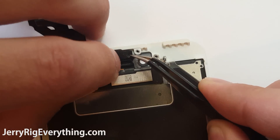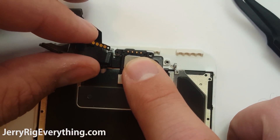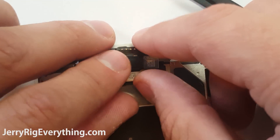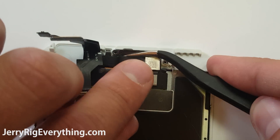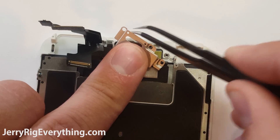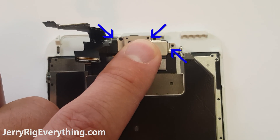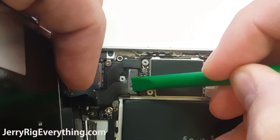Line up the microphone with its little plastic pin at the top, and get the sensors in place. Then take your earpiece and put it down, making sure the little niblet is tucked inside that little hole. Each of the little gold springs will line up with the gold circles on the ribbon cable — it looks a little messy but it sits down pretty well once you get them all lined up. Place the metal plate down and put those 3 screws back in. Then take your ribbon cables, line them up, and click those down into place just like little Legos — all 3 of them.